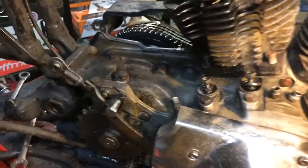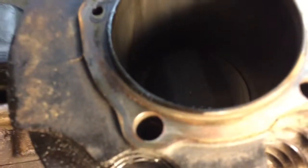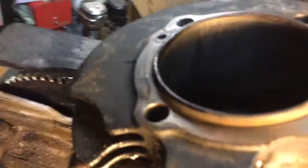Just go over this couple things you found. Remember, everybody said it was leaking from back there, as you can see. If you look down there, you can see exactly where it was. See that wetness by the back of the cylinder right there? Right there. If you got oil in there, that takes up space, you're losing compression.